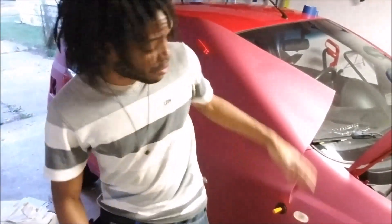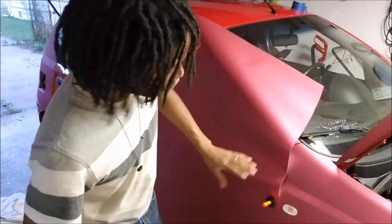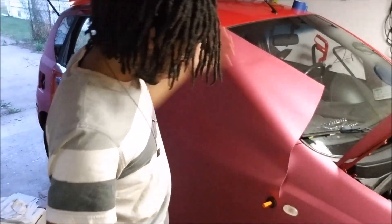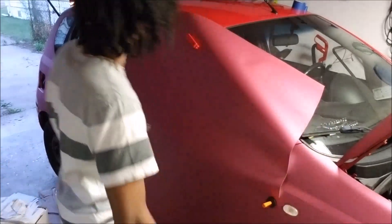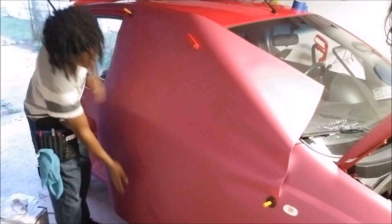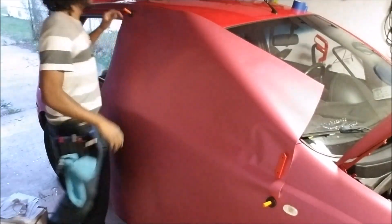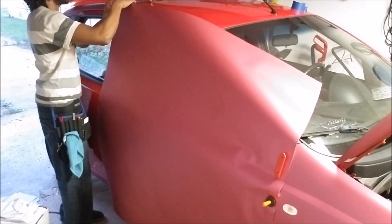Hello world, I'm Julian and today I have with me my 2008 Chevy Aveo that's going to be vinyl wrapped in matte pink. I'm going to be doing the passenger front door. I already have the piece cut out, the surface sanitized and wiped down, fingers are clean. Now the only thing left to do is pull this backing paper off, which is the hardest part. I have it cut to the bottom, top, and sides, so I'm going to put a magnet there and start peeling from this side to get the backing paper off.